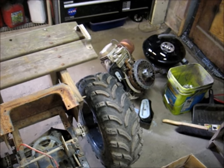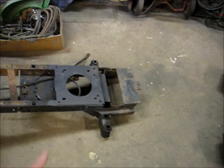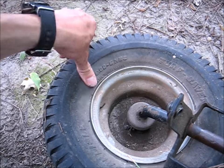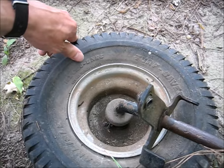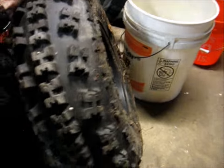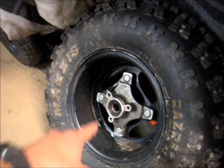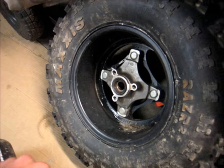I'm in the process of making some bigger front tires fit on here. Here's the stock ones — 15 inch tall. We're going up to 21, so that's gonna be pretty crazy. Here's the wheels and tires I'm going to be adapting to fit onto the front of this mower. They're Maxxis Razor 2s, TRX 450 bolt pattern — that's an actual TRX 450 hub there.